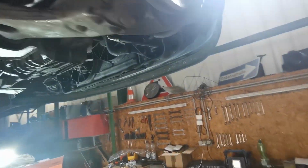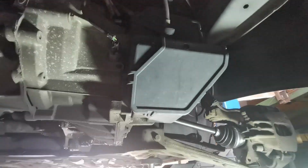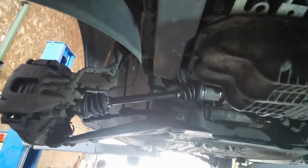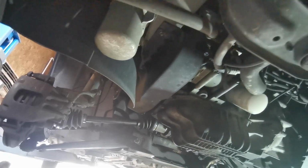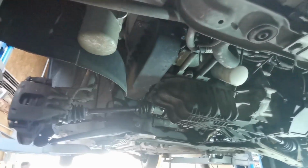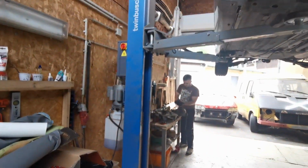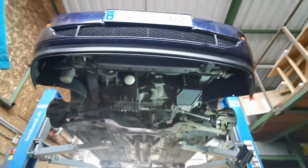But as you saw, the screwdriver trick worked. We needed a screwdriver just to hammer the axle stub out through the diff, through the gearbox, which of course was kind of difficult because we already had to put this in. So we had to remove it again, unfortunately. But fortunately that took all of, I don't know, 5 minutes max, if that, because we hadn't tightened anything down and it's all new. Anyway, we're gonna try that again, and then we're gonna resume back here, hopefully with the installation of the last bolts.